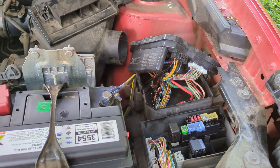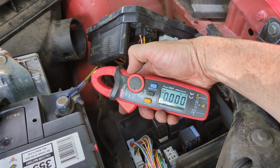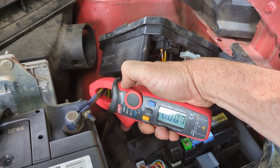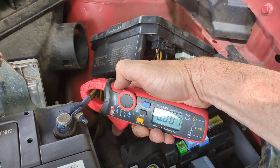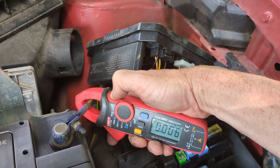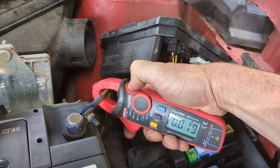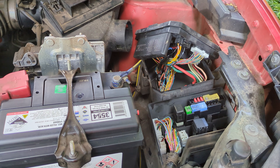It is now operational again. I will actually measure the current draw here — I've zeroed that. You've got to zero these things because you move it and the Earth's magnetic field gets in the way. Standby — what do we get? We get jumps from 70 down to 7 milliamps up to about 20 milliamps, something like that. That sounds reasonable. I did disconnect the ABS ECU fuse as well — that F19 one — makes no difference, so I'll just put that one back in. That seems a reasonable current draw. Leave it in the comments down below — I don't think that's going to drain the battery.